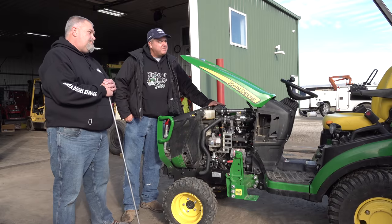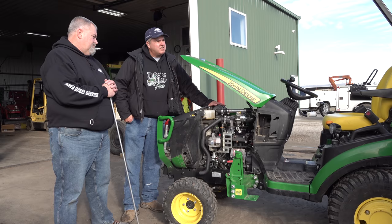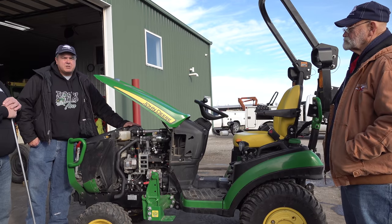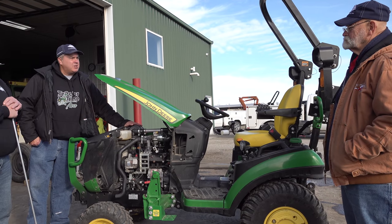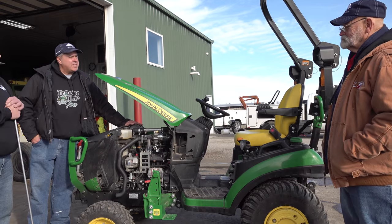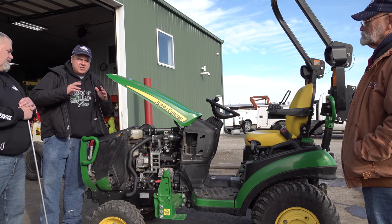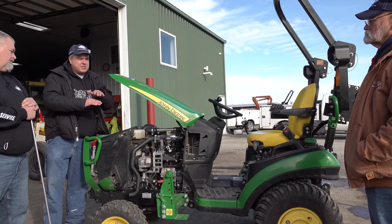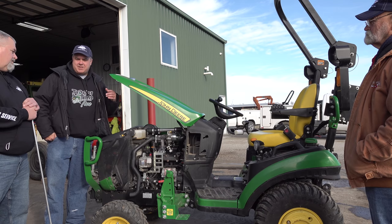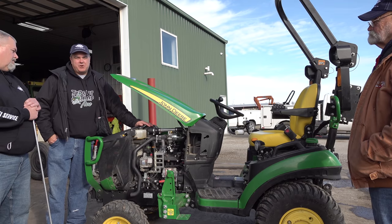But I'd like to see you try your loader on it. And when you get into that pile of dirt, instead of coming against a stall, it spins all four wheels. You'd actually like to see it spin the wheels. So it's a little question we've had off camera is whether it will spin the wheels or whether the hydrostatic transmission will continue to just give stall. The relief pressure, but the hydrostatic itself will stall out. I don't know. What we had noticed before is that the engine RPM would decline and the hydrostatic transmission would go into pressure relief at about the same time. And so Val is thinking maybe that the engine RPM won't decline now, that the hydrostat will be forced to do a little bit more before it gives up.